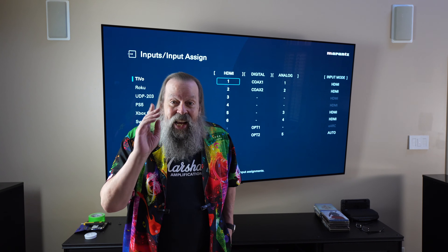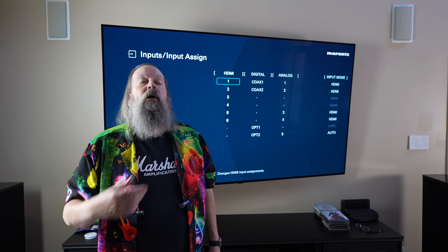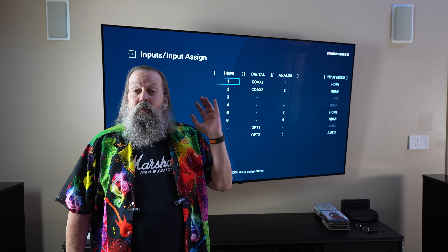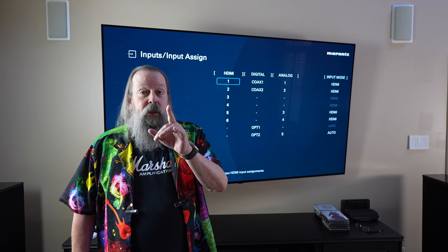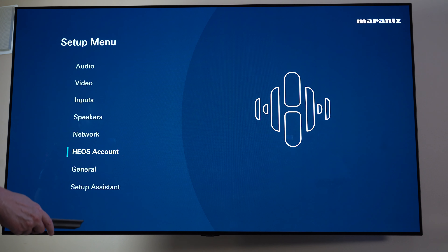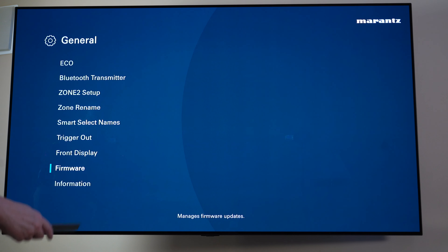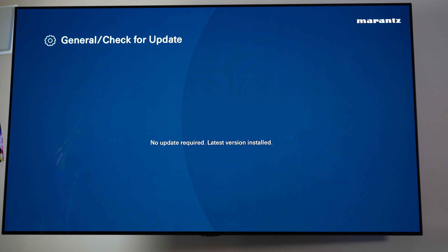That explains an hour — but why is it days later? The next hour was spent trying to fix the problem I had with the rear heights not working. I tried everything: re-plugged, everything you could do. Then I remembered there's one other unboxing and setup of Cinema 50 on YouTube, and I went and watched that. He had a problem with his Cinema 50 too — different problem, not the rear heights. He had to do a firmware update. Of course — firmware update. So you go to Setup, then General, scroll all the way down to the second page, and there's your firmware. Check for update. I'm good — I just installed the latest one a couple of days ago.